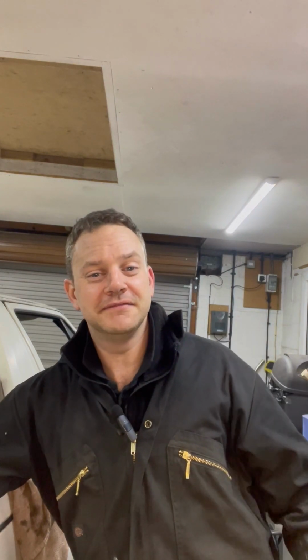Right, it's now Tuesday evening. This is really testing my skills and my patience. So Sunday night, I ran out of welding wire, which is fine. I've got a spare emergency backup, which is a cheap one, and I'm just getting nowhere with it. It just kind of lays on top of the metal. It doesn't melt into it or penetrate it or anything. So I had to ditch that, and now we're back here tonight. So let me show you where I'm up to.